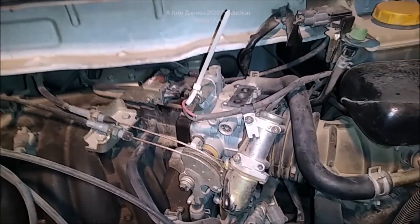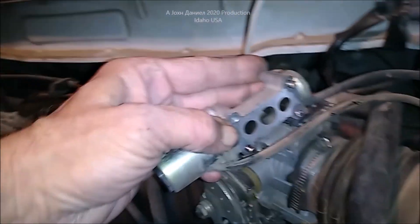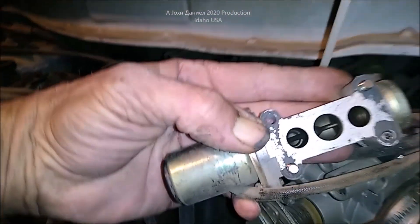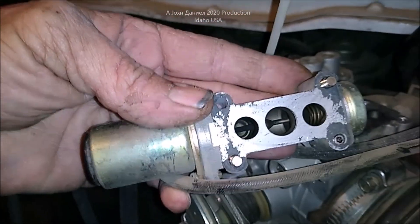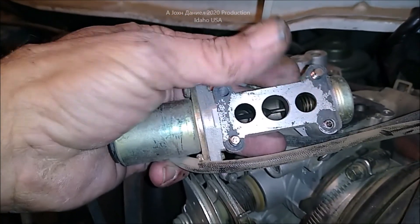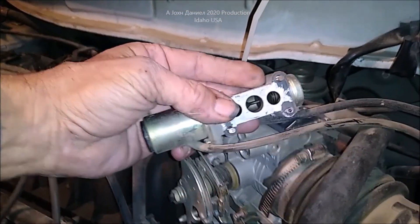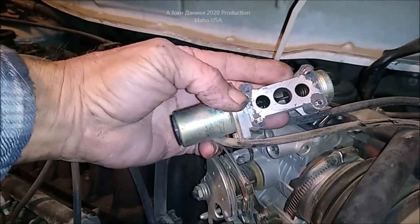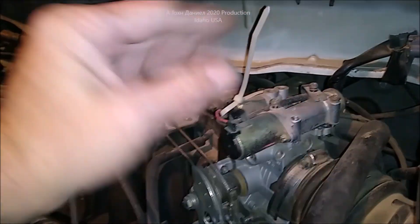Your engine will advance itself, and that's plenty of air for an idle at about 850 instead of 600 to 650. So I'm going to get this cleaned — it's really simple. Using carburetor cleaner, you can see how gummed up and nasty it is in there. Instead of those two valves opening and allowing air through the center, it's getting stuck. At 170,000 miles — anything over 50,000 if you use lower-quality gas — that's the result.